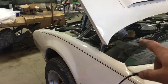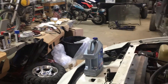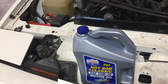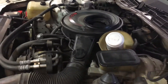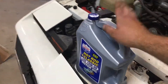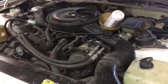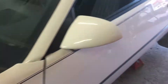I dumped about a quarter quart out, added about two quarts of oil, then dumped the rest in. I'm going to add the remaining oil to the engine — it's a five-quart container so I have one quart left over for when she burns oil, because it's a small block. Also worth noting: zinc does hurt catalytic converters, but this car doesn't have one anymore, so the extra zinc should help that flat tappet cam.